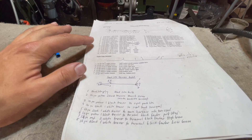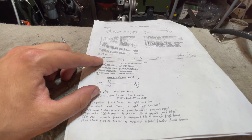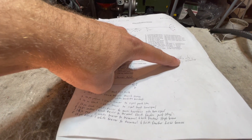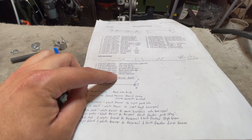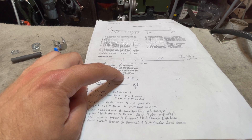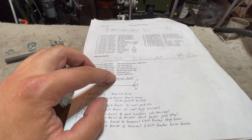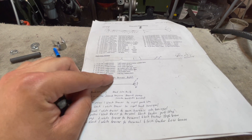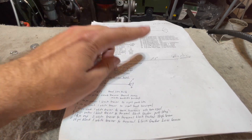This diagram comes from LOX 4 Wheel Drive Parts, and we'll be connecting the alternator to our right side harness, or splicing it in to number 7. Number 7 is your 12-gauge red with 3 white tracers. This would normally be for your voltage regulator battery terminal, but since we don't have a voltage regulator, we can bypass it and wire number 7 straight into our alternator.